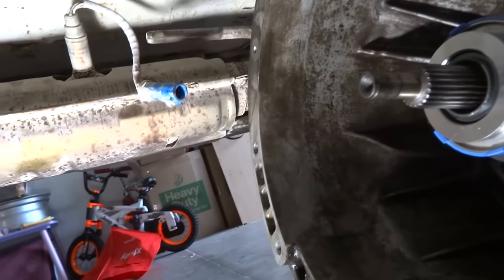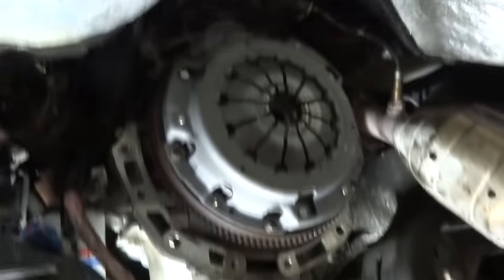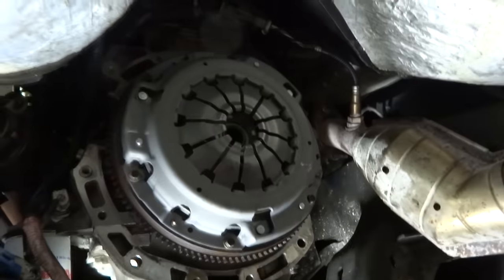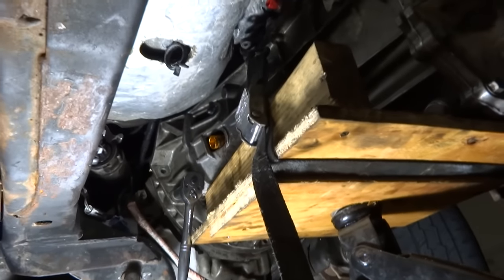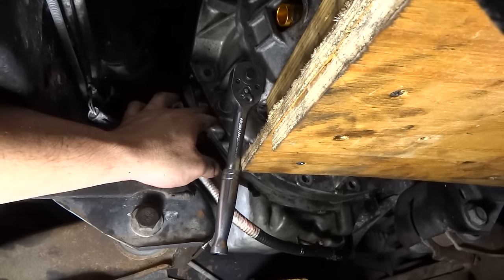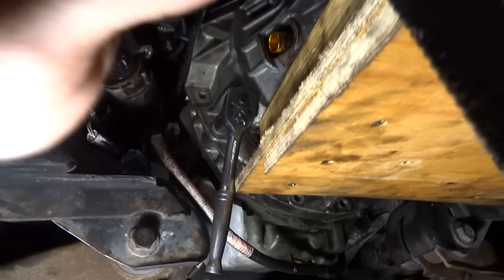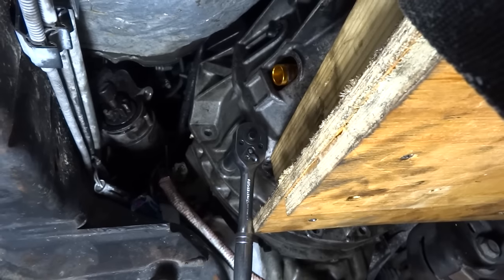The transmission is going in right now. I've got the top of the hat on where the shifter is all done, clutch is all ready. Just make sure all your wires are out of the way and slide it forward. I finally got it in after about an hour of wrestling with it. You're going to barely get the spline in, then put a bolt, line it up, tighten halfway, and push up and down slowly until it locks in. That was a pain with just one person even with a jack stand.